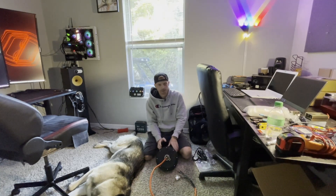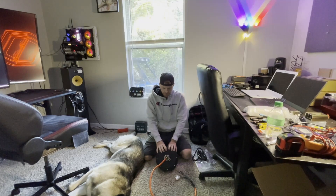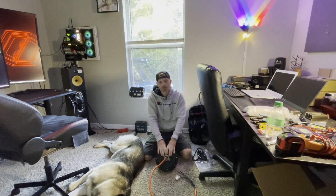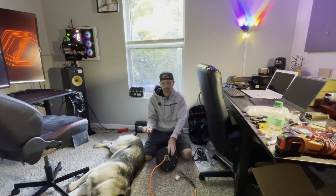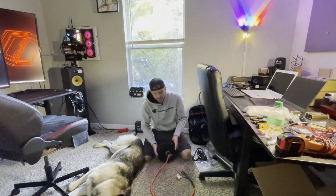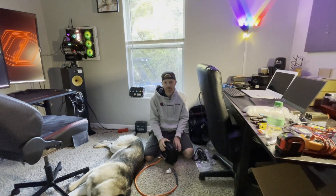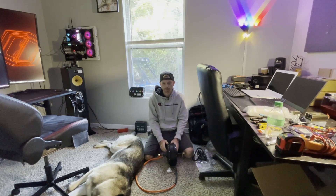We're going to have 850 phase amps to drive it, so torque won't be a problem. We'll have similar acceleration to what we did on the easy one and a higher top speed before we hit flux. This motor is wound exactly like our QS260 on the Grom — that bike went 13.05 in the quarter mile at 100 miles an hour. This should be capable of that and more since it's in a lighter bike, although we have slightly fewer battery amps.